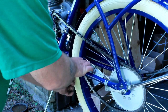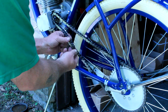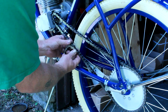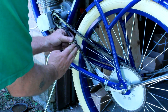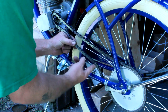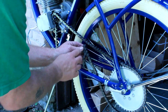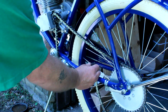Pull your chain underneath and bring it together. I've got some links to remove. The master link is going to take the place of one of the links that has the larger face — not the inner link. I'm going to cut the chain, break the chain right here. When I put my master link in, it'll be at this length here. I will have my chain tensioner which will take up the slack, and this will give me a satisfactory fit. So I'm going to bend the link over here, and right here is where I'm going to break it.